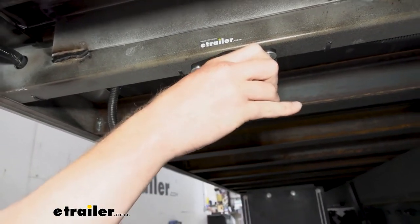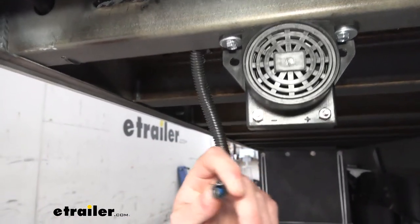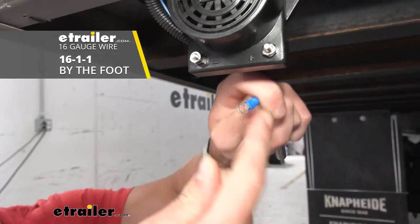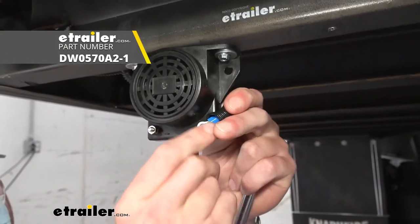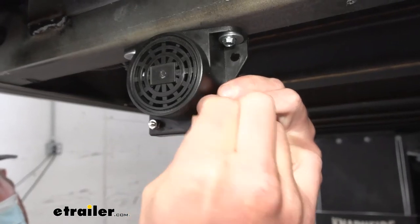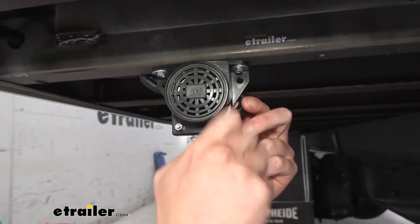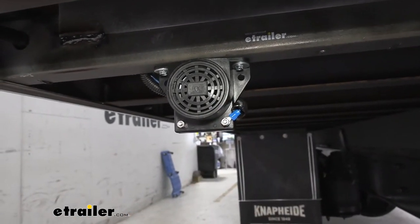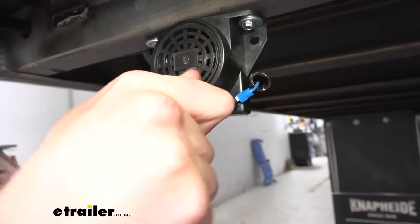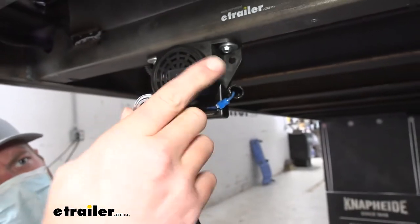Now that it's mounted, we can start working on our wires. Once you find your signal wire for the reverse lights, you're going to need to grab some extra wire — we have some here at eTrailer. Add that to your cart, and then add a little terminal like this. Slide that in and tighten it down. I like to get it threaded on by hand first, get it pretty tight, and then you can come in with an 8mm socket. I don't want to over-tighten this, so I'll tighten it by hand and then just do one little turn with the tool.